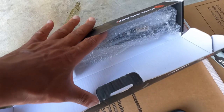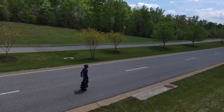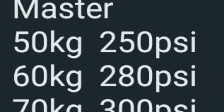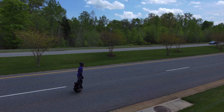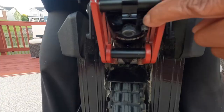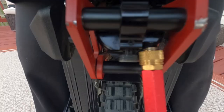Off the brake and out the box, this wheel setup fell short of performing the way it was intended to. The PSI pump supplied for the Master is useless to western riders, and the lack of instructions on the proper PSI to fill the air chamber leaves a lot to be desired. According to Begode's instructions, anyone heavier than 154 pounds needs a PSI pump that can fill the air shock higher than 300 PSI. Because the stock pump maxes out at 300 PSI, anyone weighing more than 154 pounds riding this wheel is underserved. Additionally, because of the design of the air dampening, care needs to be taken when retrofitting an aftermarket pump, as not all PSI pumps are designed the same — some have retractable metal connection valve tips that cannot properly fit flush to the air stem valve, rendering that type of pump useless.